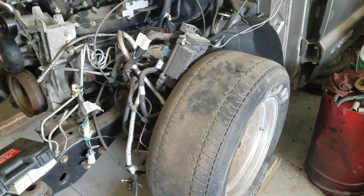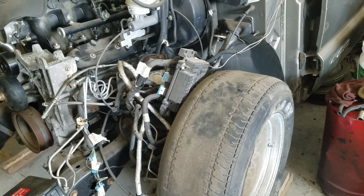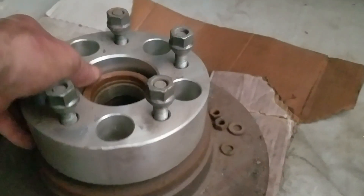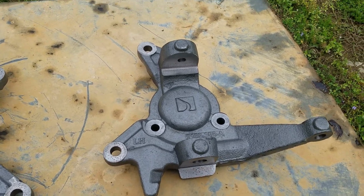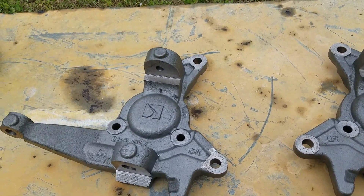On the front, it was needing two inches per side, and I had these spacers. But on a stock brake rotor, my hub centric spacers would not bolt all the way up flat. So I had already put two inch drop spindles on this thing — the old school style.